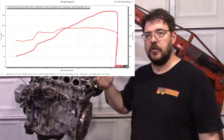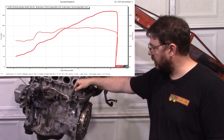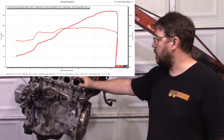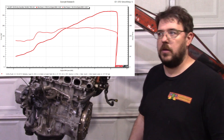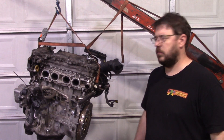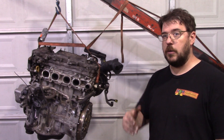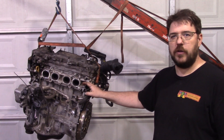If we take this current graph that we have, we can improve that by going to 2.7 liters. We can improve that by going to 12 to 1 compression ratio pistons, keeping our big cams, and then for fuel, going to methanol. Methanol is technically actually less energy dense, but because of the amount that you have to squirt in before it goes off, you end up with more energy in the cylinder. So I think from here there's a really clear path for the drag racing engine, and that doesn't even include things like porting the head to increase the volumetric efficiency.